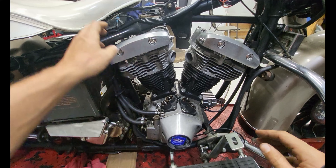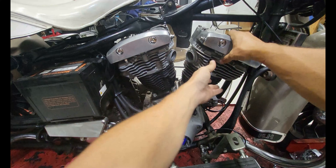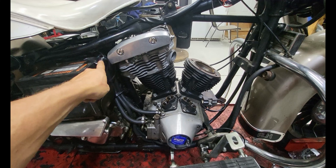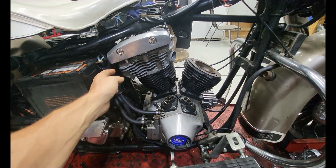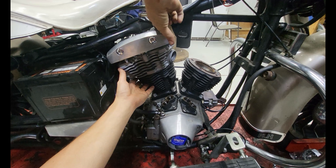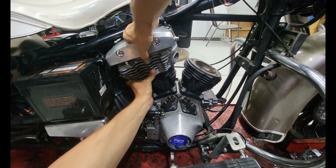You've got to get rid of your gas tanks, anything that comes down below this rear frame. Front head - plenty of room - lifts up, pulls out, sits down. Have something to sit them on. Now, a quick trick: you see this right here? That's your positive battery terminal. This is a ground, so you either take your battery off or cover that up. Grab your head and there is just enough room.